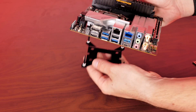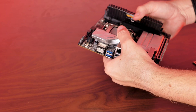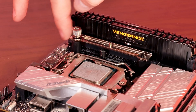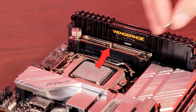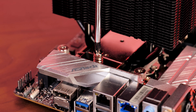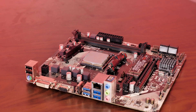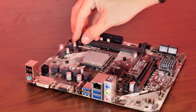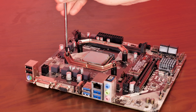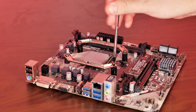For the installation on Intel 1200 and 1150 sockets: place the included Intel backplate, add the spacers, place the brackets on top and screw it down with the thumb screws — just make sure that little dingle is pointing upwards. From here, you can simply add your cooler and screw it down with the pre-installed screws on the side. For Ryzen CPUs, remove the black retention brackets, place the spacers with the brackets on top while making sure the tab is pointing upwards and the brackets are pointing inward, then screw them down with the longer AMD screws.